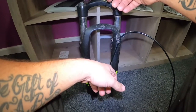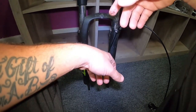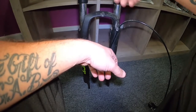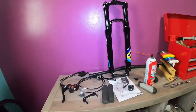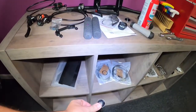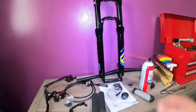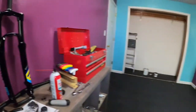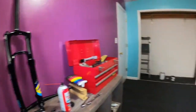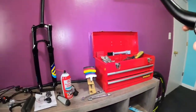When I get this off I'll measure it up and match it with my new fork, then get it cut. I'm going to do a separate video on measuring and cutting the forks - I've already done it a couple times on other bikes. I already need a new star nut to put in there - you don't want to tear one out and reuse it, they're not that expensive. I'll be keeping my top cap and the same spacers. With the new fork it's going to raise the front end of my bike anyway since it's an inch and a half higher, and I'm going to be reusing the same stem.